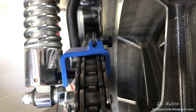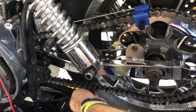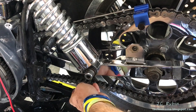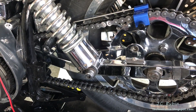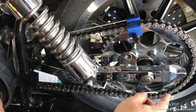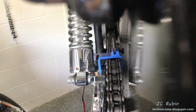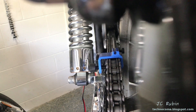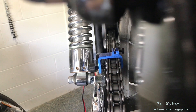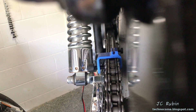It's important to note that every time these adjustments are done, the slack needs to be retested and readjusted if necessary. Again, slack is adjusted on both adjusters in the same direction in unison. That slack adjustment can in turn require a readjustment of the alignment, so keep the chain adjuster tool on there until the end. But once the chain alignment is perfect and the slack is perfect, it's time to lock down that rear axle.